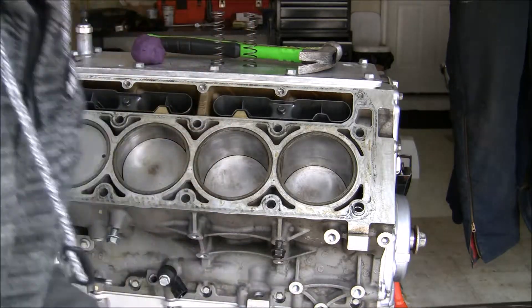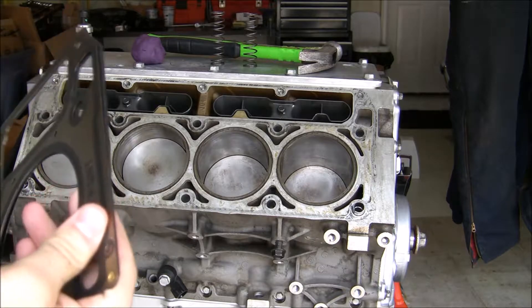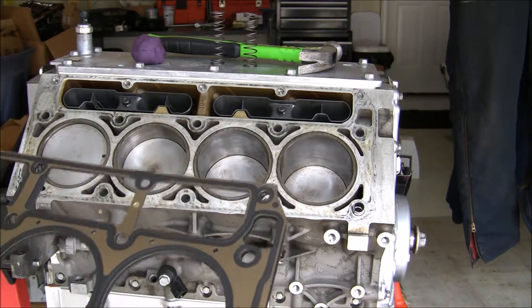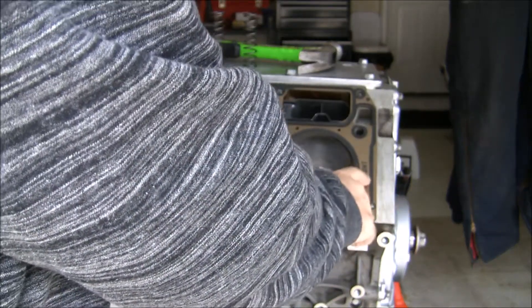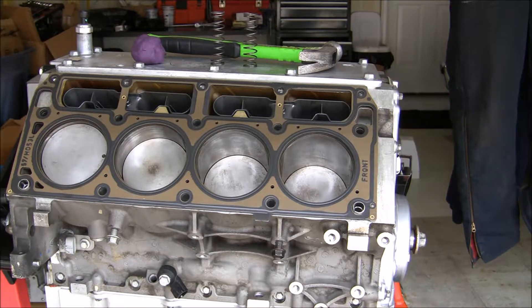Next, I'm going to throw on the cylinder head gasket. I'm not going to tighten it down too tight. My plan is to throw this on here like so, where it says front. I'll just kind of tighten the bolts but not too hard. They are torque to yield, which means they stretch, so these ones are shot anyway. I'll get some new bolts — probably some ARP bolts — but I'm going to reuse the stock ones for now just to get the heads on so I can measure.